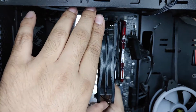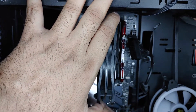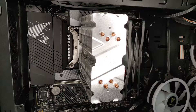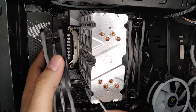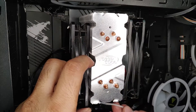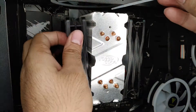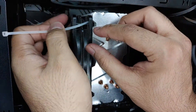The included fan is blue — a fixed blue LED. But I had three or four extra fans lying around, also from Deepcool, and I installed one on my CPU cooler. Make sure whenever you're installing a fan on your CPU cooler it has four pins — unlike some which have three pins. A four-pin fan has the ability to control and adjust fan speed according to the processor temperature. I'm attaching another similar 120mm triple LED fan from Deepcool, using zip ties as I've seen in YouTube videos.